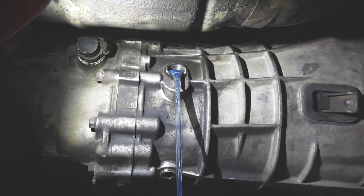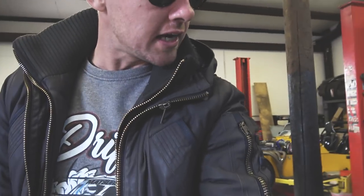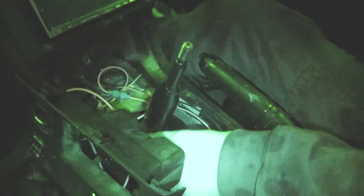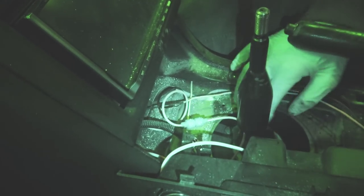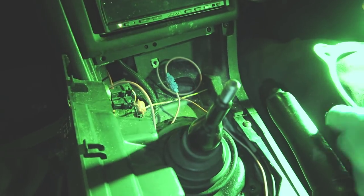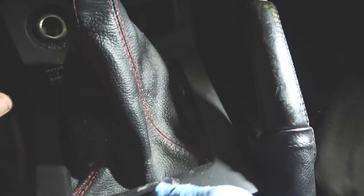Scousey's just going up the top of the car to top the gearbox up with oil. I'm going to be his eyes down here and monitor when it starts pouring out of the drain plug. The R33 is now finally back on the ground. We're just going to remove the stands. We'll have a little bit of lunch and after lunch we'll take you for a test drive. We have finished our lunch. Just going to jump in the passenger side. We're going to put the shifter back in - literally slots in like that. A little circlip ring here - all good. Wayne is getting us another shifter boot, really common for splitting. Now we're putting on the rubber boot - there's a little cover which actually has an arrow at the front. The shifter is all good to go. Now we've just got to put the gear gaiter back on and this little centre trim.